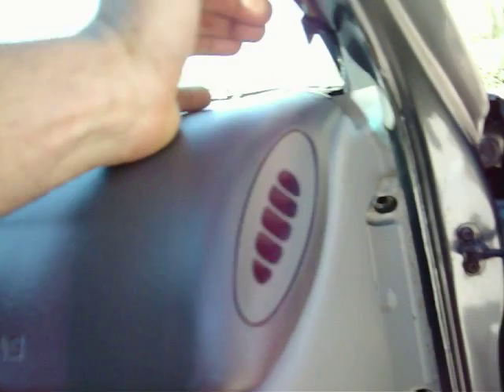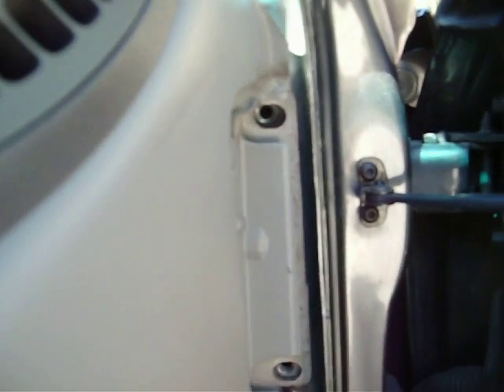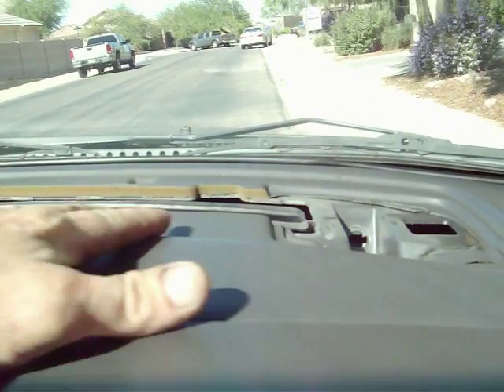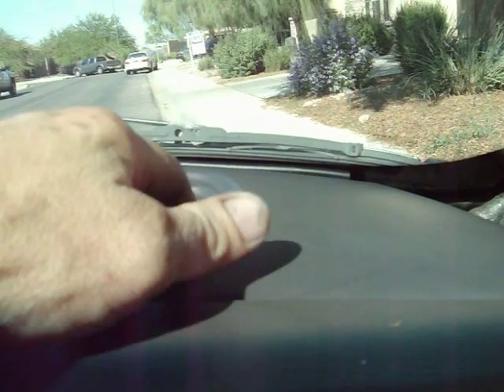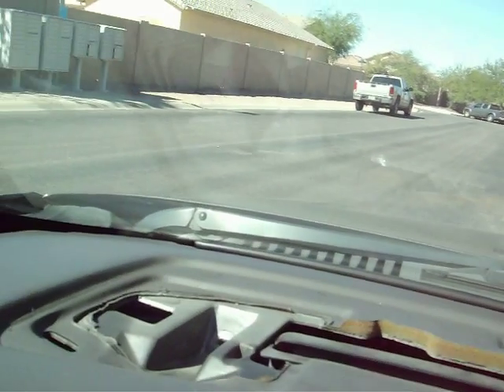There's a panel on the side of this car — I'll show you the panel. This is right on the side of the dash. You want to pop that panel out, and then there are two bolts there you'll need to take out. These pillar trims above the dash — you need to pull those out. Just grab from the top and pop them out, there are no screws. There's also a cover up here on the upper dash that's easy to pop out — just get your cat claw, stick it under there, and pop it out. You're going to see three 8mm bolts in the back: one on the right side, one in the center, and one on the left. Take those bolts out.